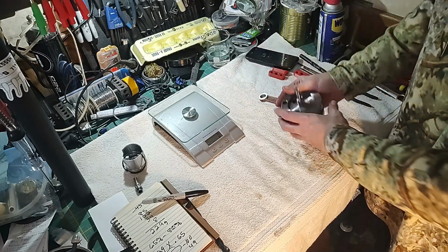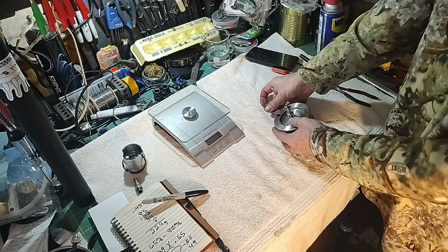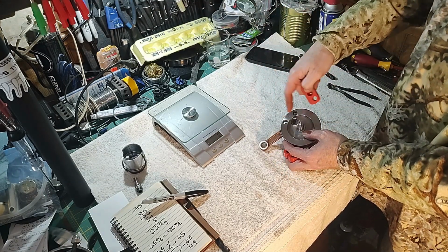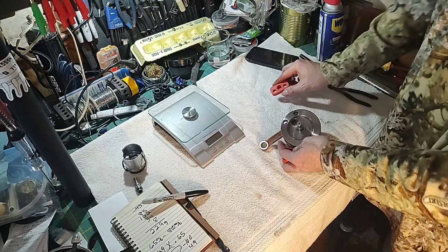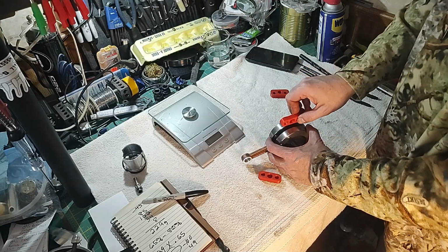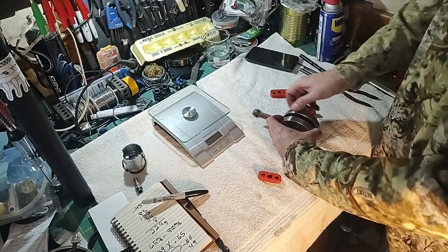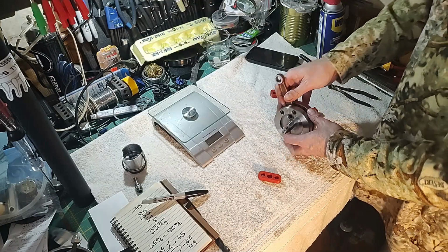So then I came up with this idea of, well, let's try to somehow create a jig so I get these holes in the right spot. Kind of went through a couple renditions, a couple mistakes here, but this is the final one. Essentially, this hole is higher than these two holes, and that gets us right there in the middle. But I'm keeping these because I realized that when I'm drilling it, I really want something kind of wedged in the sides here. So when I'm pushing down on here, that this won't change at all. If these become shifted on the shaft, it will start wobbling from that.